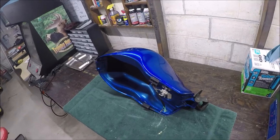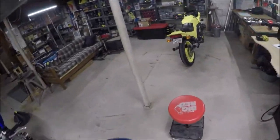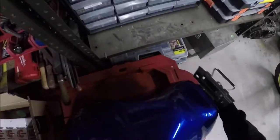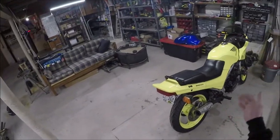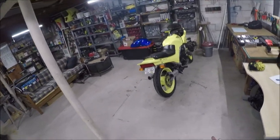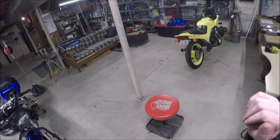They work for a little while, but then they stop working and it's a thing you gotta deal with. I'm going to delete it on that one. At least the interceptor has a true off position. Suzuki decided we don't even need an off because the vacuum operated petcocks are going to work so damn good - they just went with prime, on, and reserve. Honda had a little more foresight when they designed this one in 1980, probably 82 or 83. I just wish I could have been there when we made the decision to move to vacuum operated petcocks, because I think I could have raised some good points as to why we shouldn't have. Thanks for watching.